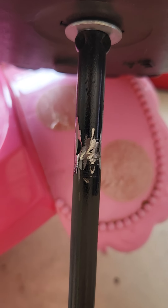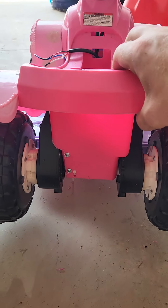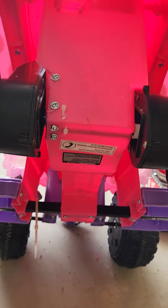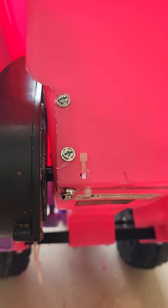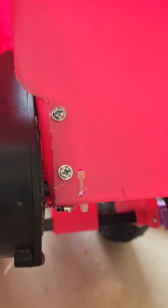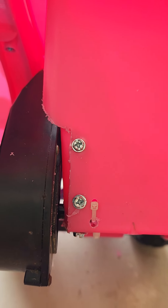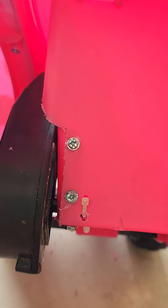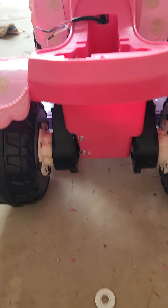Here's the finished product — it's got some screws and a couple of zip ties holding the axle steady. The axle doesn't spin, so you just need to hold it in place. I had to make the hole a little larger on this side to align the axle, because the thickness of the plastic lifted and pushed it forward. I made the hole a bit bigger, pulled it back and down as tight as I could with two zip ties. Now the axle's in really tight, everything's aligned, and it sits perfectly. Now we just have to wire it.